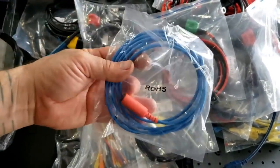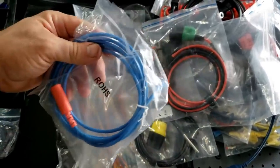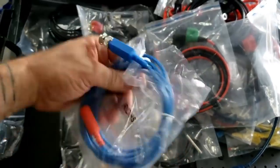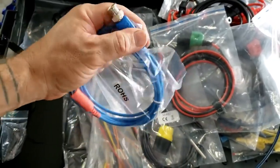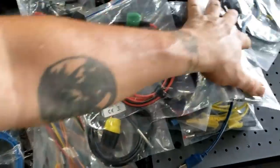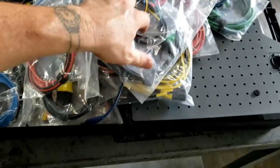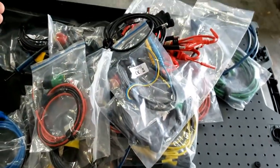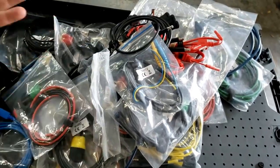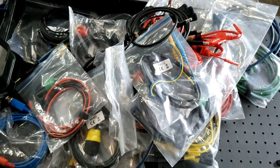Ultrasonic detection, I think for parkade, I think in some cases keyless entry, I can't remember. At one time they had 2 different leads, they may just be using one. This one doesn't have the BNC Plus, which is fine. That's one thing I forgot to mention, if I can put this stuff back, is you can still use regular BNC leads. So if you already have BNC stuff or your old Pico, it'll still work. You just have to go in and tell the channel what probe you're using.